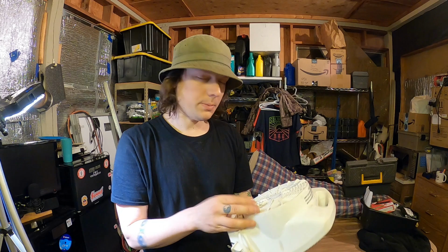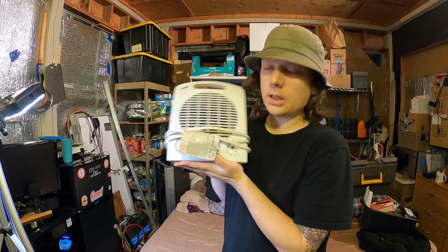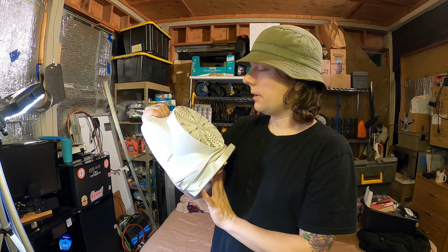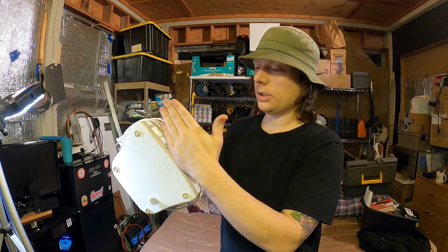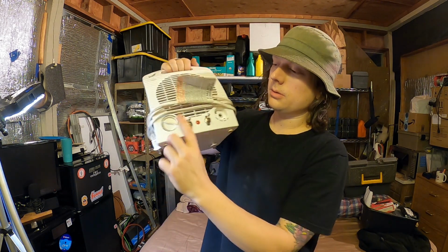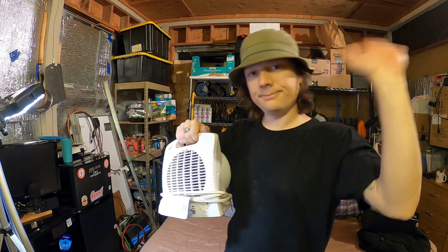If this goes in the RV, I can just put up a wall thermostat that goes to an outlet to control that. So, there you go. Quick way to fix that. If you got a heater that's got a bad selector switch, make that work manually with a couple toggles. Single pole, single throw. Thank you for watching.